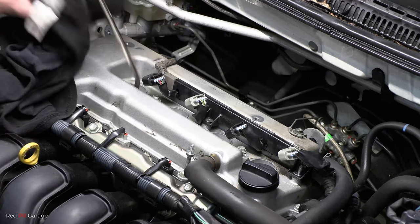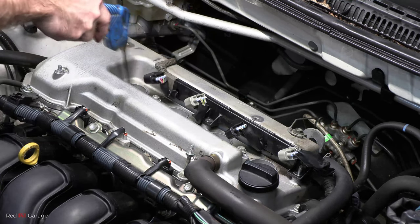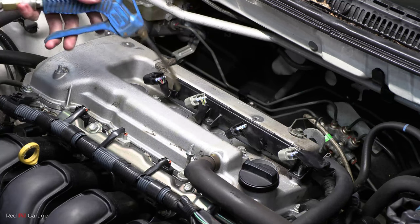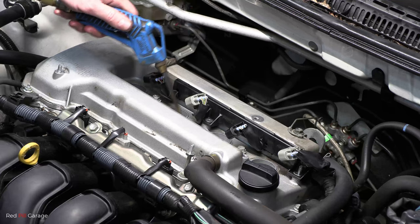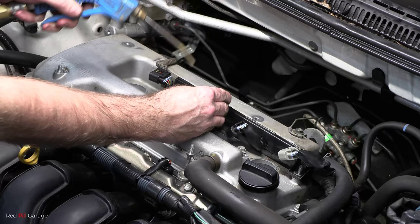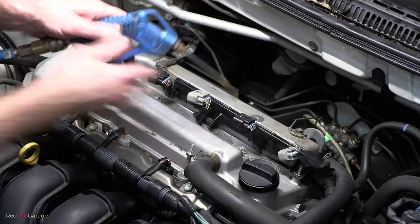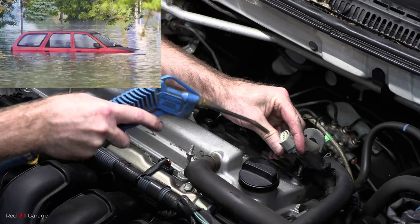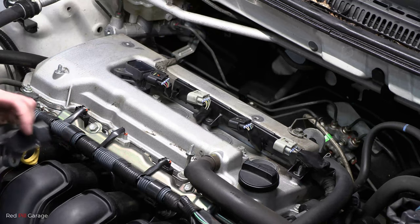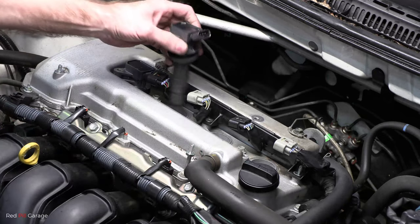Make sure you're wearing safety glasses — you can see water shooting through the side of the rag. Keep a rag covering the spark plug tube holes so water doesn't spray into your face. For those at home with a compressor, thoroughly dry out those coil connectors — there can't be any water in there whatsoever. Also blow out the coils themselves; you certainly don't want any arcing.